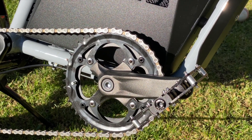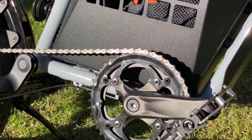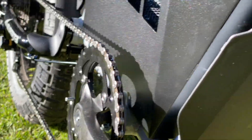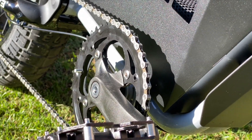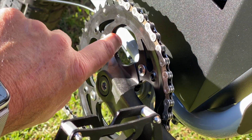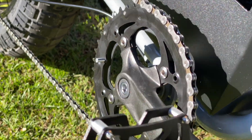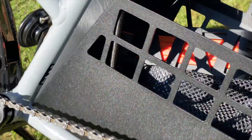In the Super 73 kit there's a convoluted spacer/washer configuration required to shift the entire chain ring and bottom bracket about three to four millimeters. I bypassed that with advice from folks on the Super 73 mod group. The chain ring in its stock form rides on the inside of the spider gear — all you have to do is move it to the outside and mount it there. The spider gear is slotted so it actually fits, and it really eliminates the need to mess with the bottom bracket.